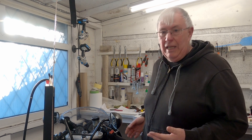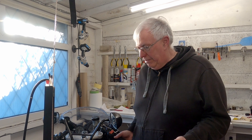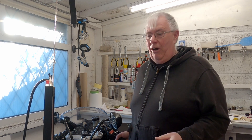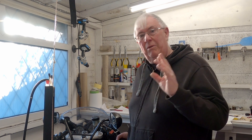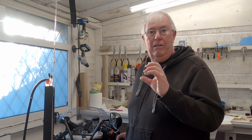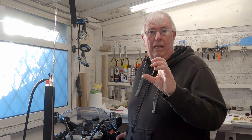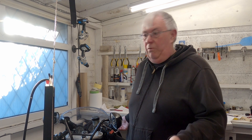The carbs are balanced now and to be honest when you're just cracking the throttle it seems a lot crisper. I can't wait to get out and ride it, but it's about minus two out there so that's not happening for a while. I actually didn't set out to do the carb balance this way - I'd intended to use my four column manometer, but only when I came to use it did I realise there was a problem. Anyway, it worked a treat. As I say, I saw somebody else do it with a dial gauge and for calibration purposes that would be absolutely perfect. Anyway, that job's done. If you enjoyed this, why not subscribe? Take care.